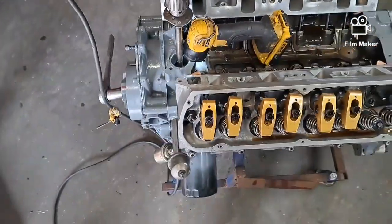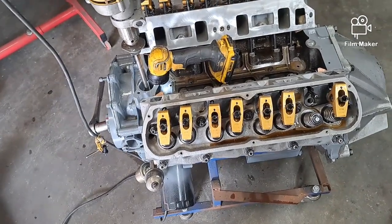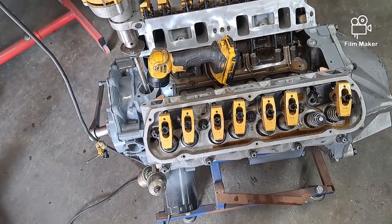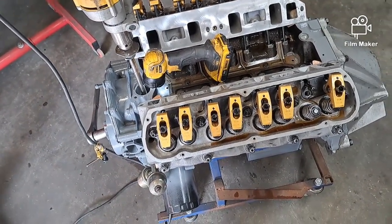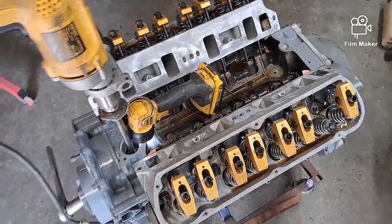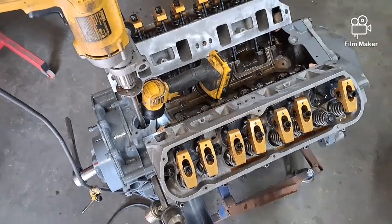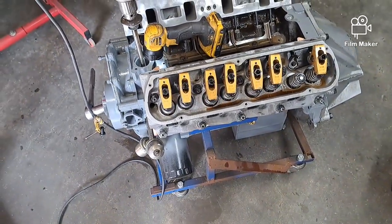I got 75 pounds of oil pressure, which is what the other engine did - I guess that's what you get with a high pressure pump and stock, unmodified bearings. Everything's going good, just two on that side are a little slow - takes a bit to fill up the push rod. I'll run this now to get oil up to everything, then I'll do it again just before I fire it. Hopefully you'll be seeing that in January. I gotta string all these clips together and get this posted - it's taking too much of your time. Appreciate you.